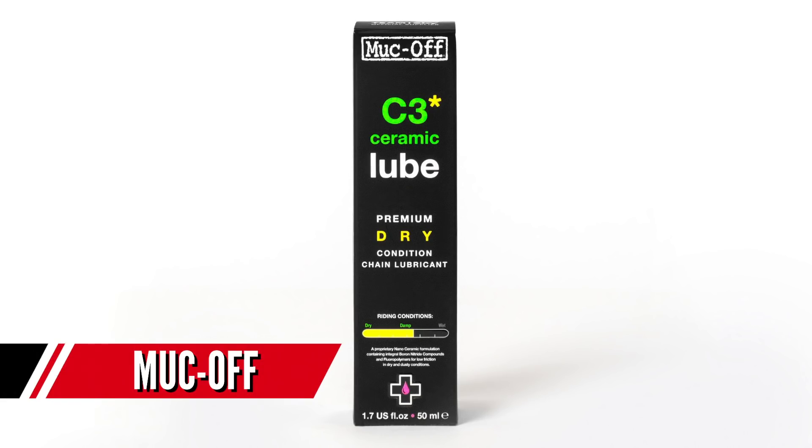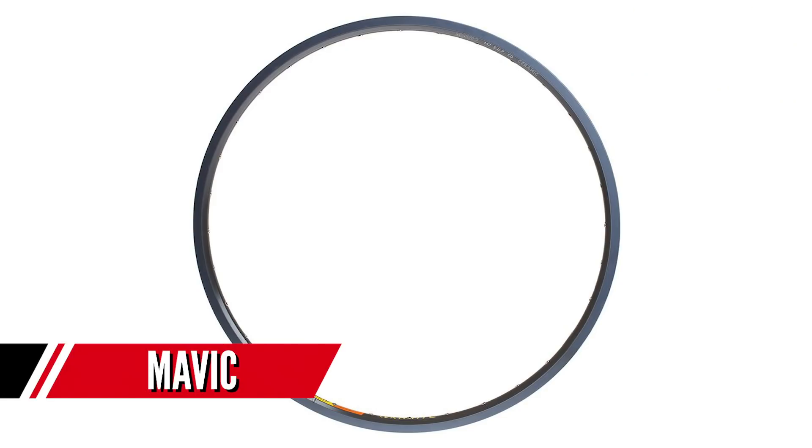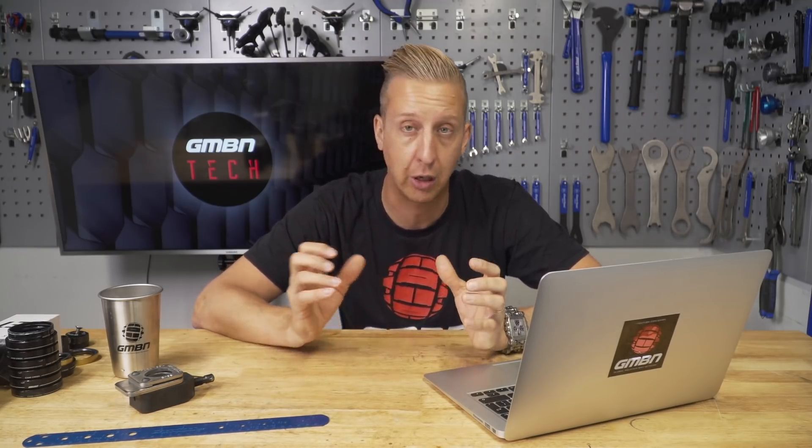It's slightly more expensive than generic chain lube but can be very effective. Another good use of ceramic to demonstrate how good it is in bicycle applications: Mavic, back when everyone used rim brakes on mountain bikes, used to offer a ceramic-coated rim. It was an extremely hard surface, almost abrasive, giving brake pads immense traction. The downside was you'd go through brake pads faster, but the upside was significantly improved braking power.